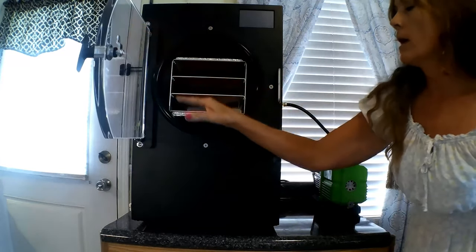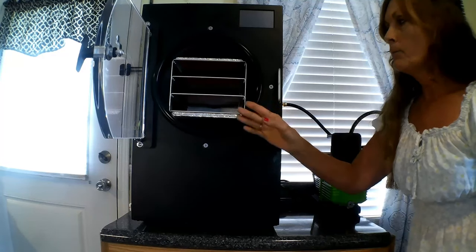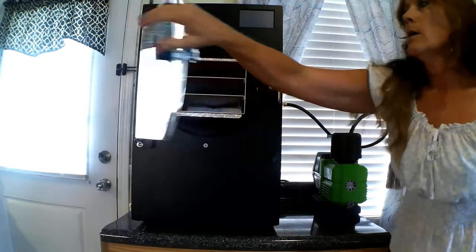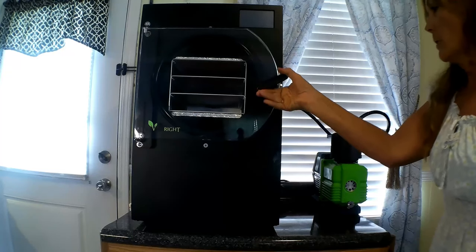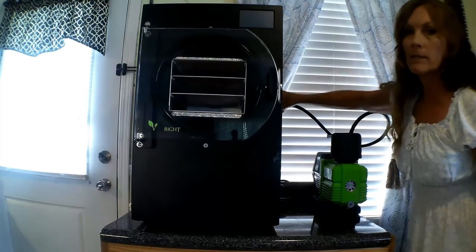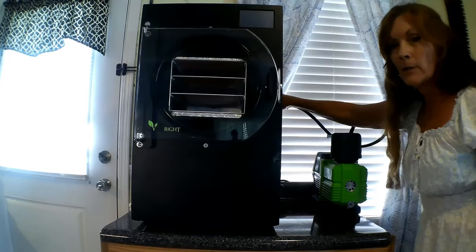With the Harvest Right, make sure the trays are pulled out and snubbed up against the gasket. Take the gasket out, rinse it off, and wipe it so there's no dust. The acrylic door has two latches — one turn and then two turns. The premier pump comes with a hose that connects to the freeze dryer; you want to finger-tighten this and then just barely snug it with a pair of pliers. Do not overtighten at the freeze dryer or at the pump.